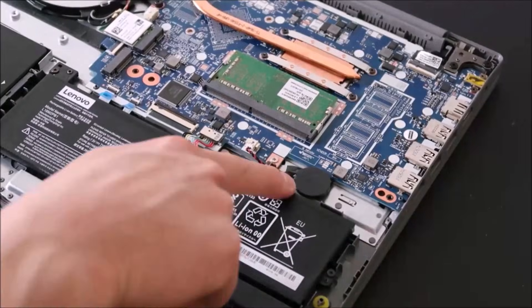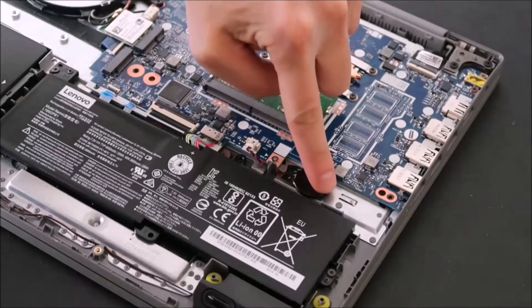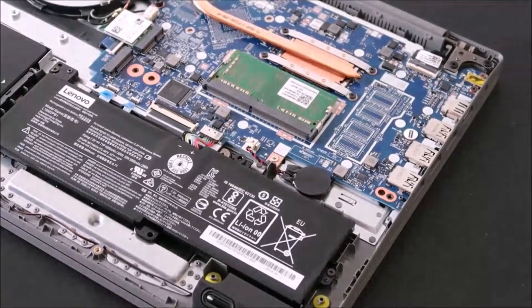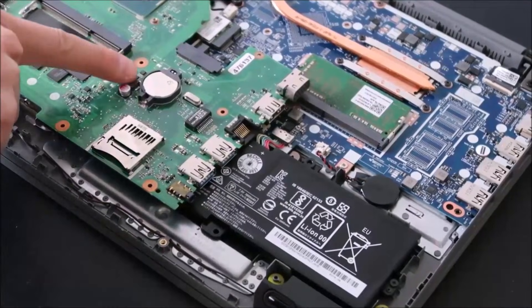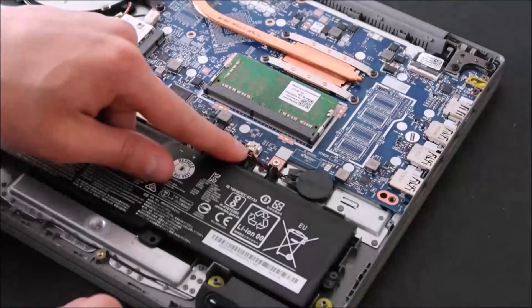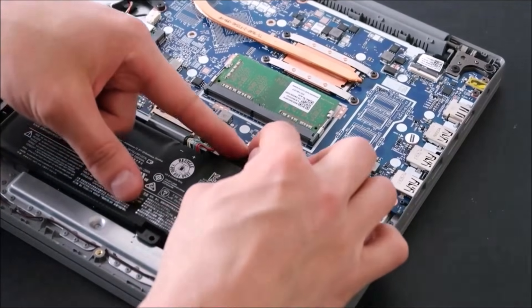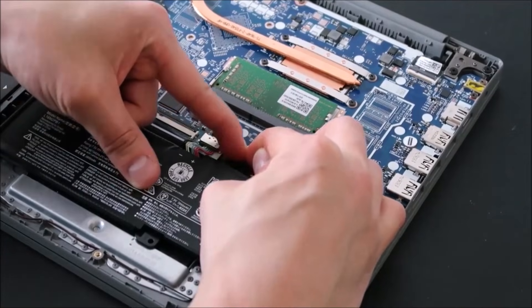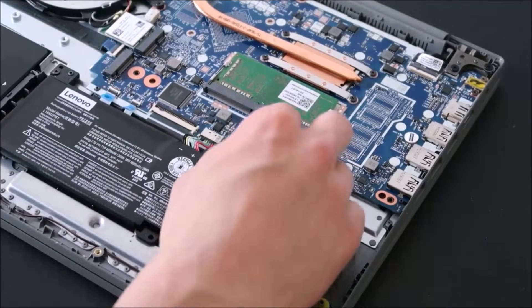The third and last test in this video is how to perform a manual BIOS reset by temporarily removing your CMOS battery from your motherboard. This is your CMOS battery — it's a small round component that looks like a watch battery, wrapped in black electrical tape and plugged into a port. Another common CMOS battery presentation sits directly on the motherboard. All you would do is unplug it from the port — don't pull on the wire; put your fingernails on either side and slide it out, wiggling it gently. Leave it unplugged for a while, then plug it back in.